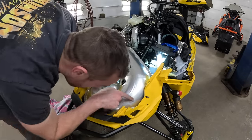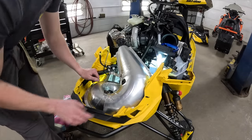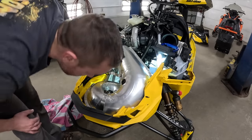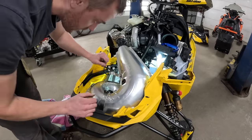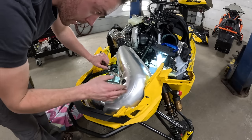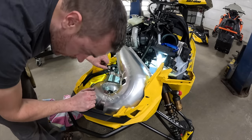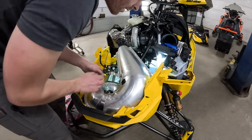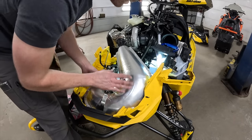So it's hitting on the bumper over here. The tin flange or aluminum flange as it wraps around is rubbing on the bumper down here. I'm gonna pull this back out and bend that flange downward so that it clears the bumper more. Everywhere else is good, but it is right on the bumper there.